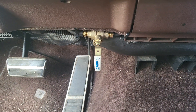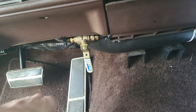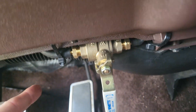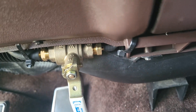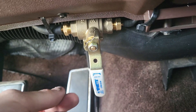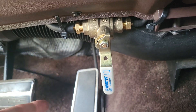Underneath here I've got a nice little valve from the plumbing section at Lowe's. I plan to 3D print a label that says 'cruise control' for it. If you look here, you can see a vacuum line hooked up on that side going up behind the dash, and another vacuum line right here going up behind the dash. This one is coming from a signal vacuum that would work with my automatic climate control, which has also been deleted because it didn't work correctly. When you delete your automatic climate control controller, you have one vacuum line that goes directly through the firewall to your manifold vacuum source behind the carburetor. That line is a quarter-inch vacuum hose — put a tee connector into it and run another line off it.